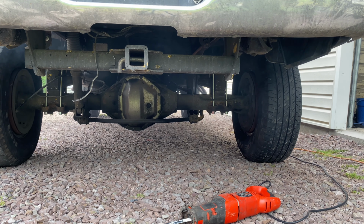I have a couple oil leaks on this, which by the sounds of it is the most common thing in the world, so I gotta work on them. I'm gonna start from the top. Valve cover gaskets, gonna replace the turbo oil feed, gonna replace the turbo drain. Just working my way down from the top. I think that's it, unless there's something on this side that's hanging me up, but it doesn't feel like it.